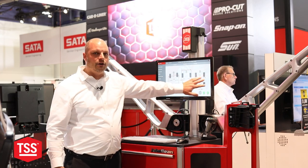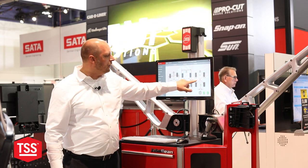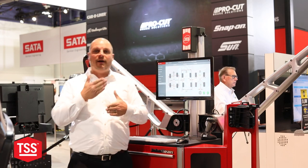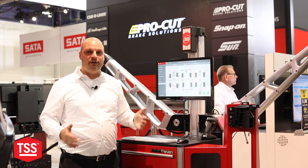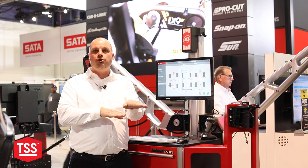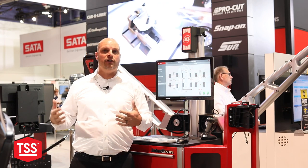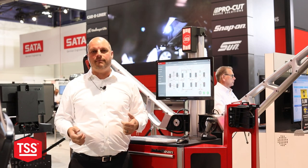On this right side here, this is actually giving you something a little bit additional, and this would be on our premium aligners. The first two numbers at the top here are my diagonal numbers, so I know if my vehicle is squared up or not. The number on the bottom is actually the geometric centerline for the front of the vehicle and the rear of the vehicle and how those two will track together. So if I see that number is way off, I may want to start in the front of the vehicle, do a cradle adjust, and get my vehicle squared up first before moving on to making my other adjustments.